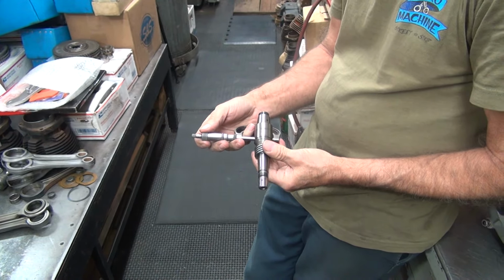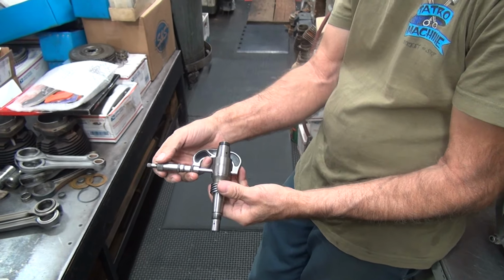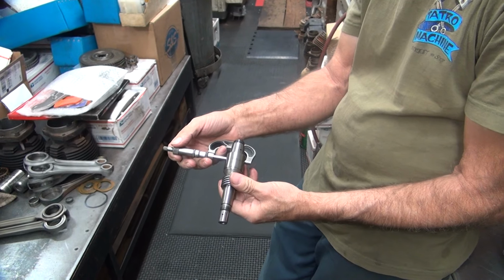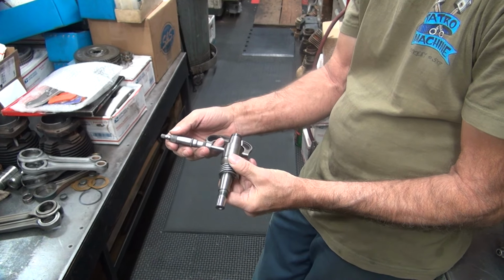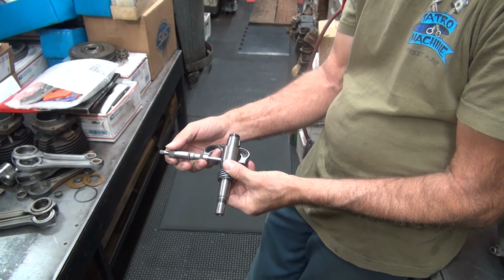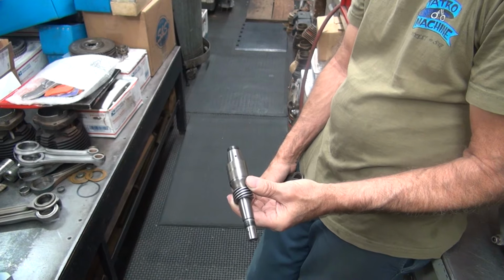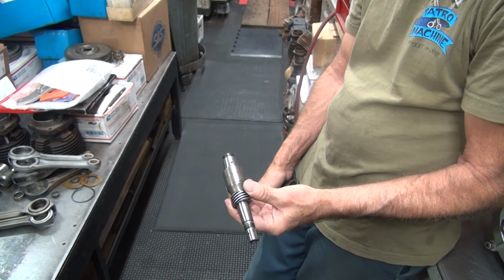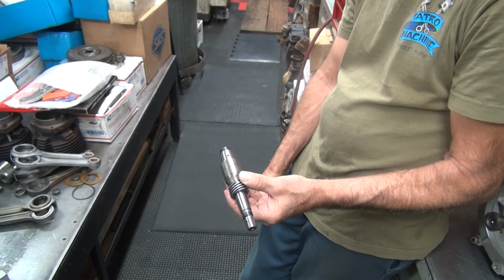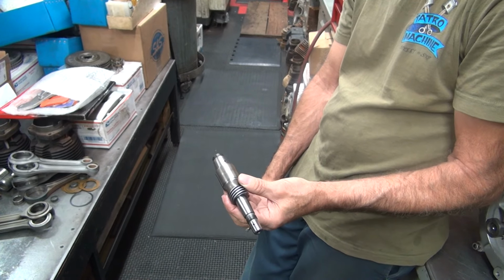This one's a big one. It's actually 0 right there, which is big. There's a couple about 3/4 tenths under that way. About 3/10 under. And that's about 1/10 over. So this shaft was not ground undersized for clearance, it was made standard. So it's 1.25 inches. Usually they grind half a thou to a full thou worth of clearance into it.